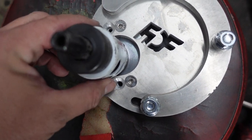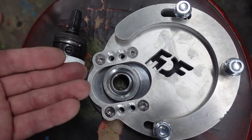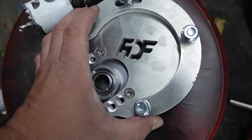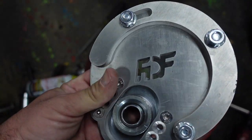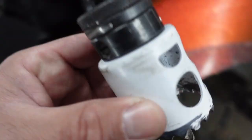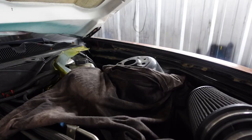With this plate design you can actually slide it around to add caster and camber depending on which way it spins. You can spin your strut out in a circular fashion — spinning it one way takes a little camber out and adds a little caster, spinning it the other way does the reverse. Let's see if we can get this hole saw to fit in that spot — and then we'll take the grinder and cut it out a little more. Make sure you wear eye protection; grinding sparks will put little specks in your windshield so protect that too.